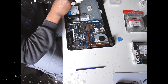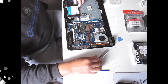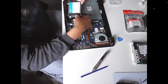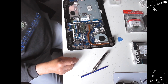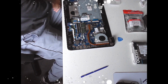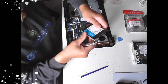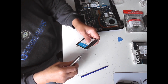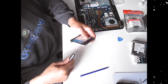There's only 3 screws on this. Pull this in. Now, there is a ribbon peel where you can take that out, but what I do is just take off the whole connector, because the whole connector is going to go back on. It saves messing about with the ribbon. So that's my previous SSD that I previously put in. Butterfingers. That's the thing about SSDs, you don't have to worry about damaging them. If that had been a mechanical drive, I would have had more problems.